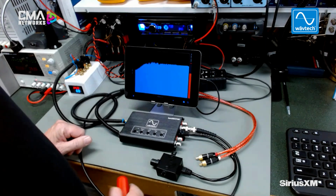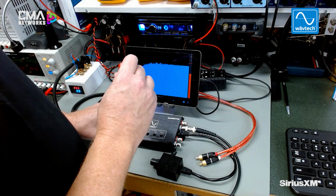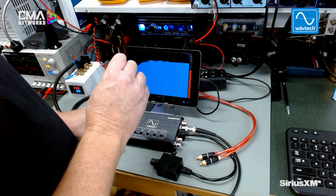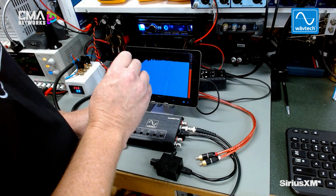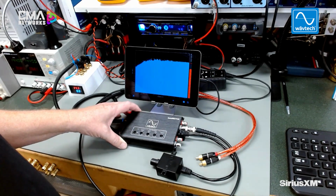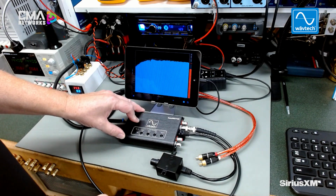And now we're going to find your initial gain setting. The radio's at its maximum unclipped volume right now, undistorted output, and we're going to play music, and we're going to start turning up the gain on the bassRESTOR until your subwoofer reaches the maximum output or the amplifier is clipping or both, because you're powering your main speakers with the main radio. And that's generally going to be somewhere around the 9 to 10 o'clock position on any of our processors here. So with that set, now we can get into the tuning portion.